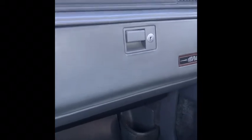The ECM is located behind the glove box. First, disconnect the battery. Now we've got to take down this hush panel — that's what the service manual calls it. It's seven millimeter nuts that come down to give you access underneath the dash. Then way down here towards the vents on the floor there are a couple more push nuts that you've got to remove. Now we've got the panel out of the way.